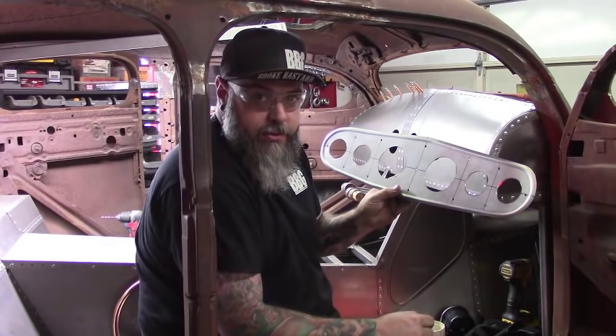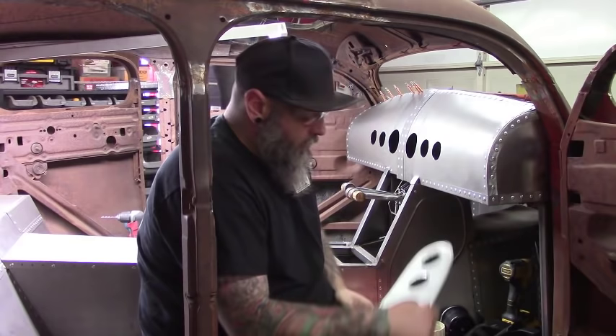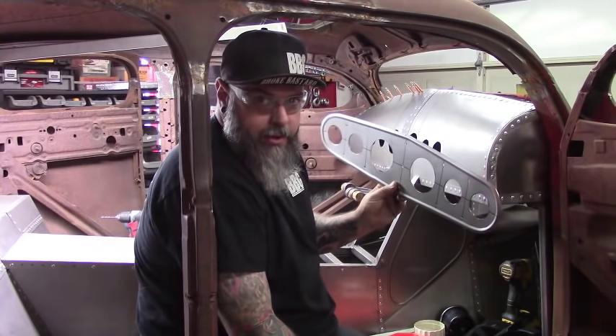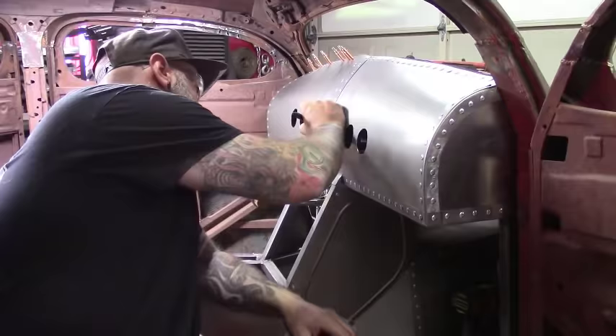I took my piece, did the layout on it, marked all my holes for the screws, and drilled them — the face plate's ready to mount. I went down to the hardware store and bought some 3/8 copper — the only copper I could find with the right clearance to fit the screw inside. We're going to lay this on the dash, mark just the first three holes since they're the closest and straightest, then measure each one and pull it in so it's nice and straight. The hardware I'm using is 10-32 machine screws — regular nuts for mock-up and then lock nuts afterwards so it tightens up good and doesn't come loose.